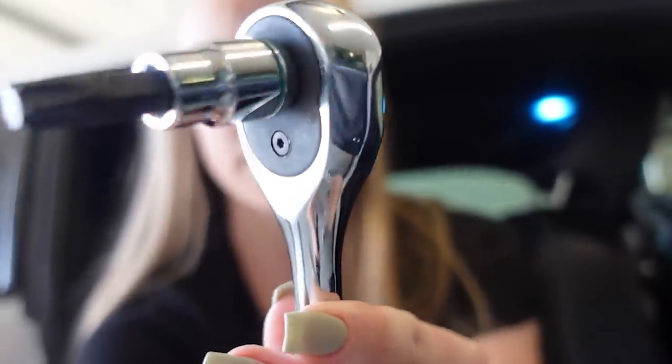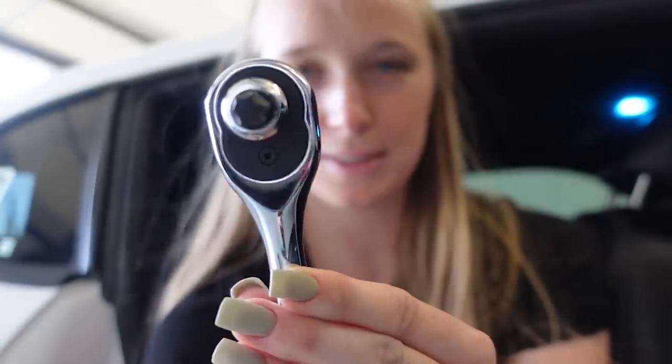This install shouldn't take more than an hour — maybe longer because I'm filming. To take off the seats it's really simple. I'm on the passenger side of my Camaro right now and I have a T50 — it looks like this, it's a little star. This is the only tool you need to take off the seat, plus a flathead to unhook the electronics. It's only connected by two bolts on both sides, so it's relatively easy. The back seats are even easier and don't need any tools. Make sure to move the seat all the way forward — the bolts are right here.